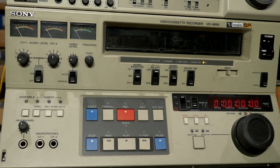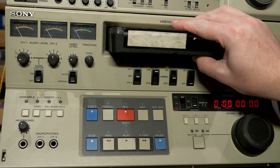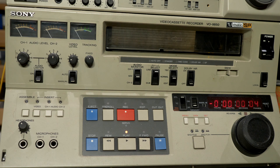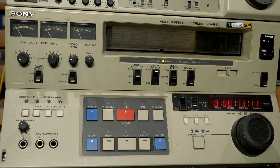This is my first attempt at rescuing a tape that has sticky shed or stuck tape syndrome. You can tell you have a tape with stuck tape syndrome because when you play it, it will generally make a squeaking sound and slow down to a stop. This is because the binders in the tape have absorbed humidity over time, causing the emulsion to stick to itself. Sometimes the tape won't even eject, but I think I caught this one in time.